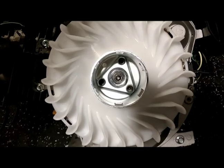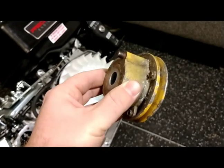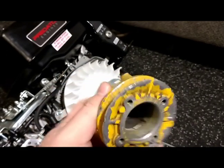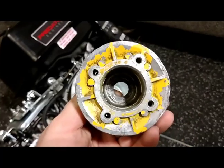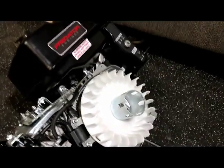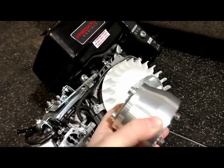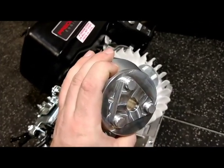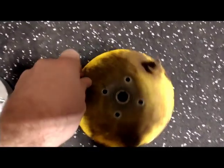Since the Predator has a triangular pattern on the recoil starter, we're not going to be able to use the old flywheel hub — there's nowhere for the gauge pin to go, and the hole diameter is too small to let the crankshaft pass through. So we need an adapter. Thankfully there's a company on eBay that sells an adapter taking the Predator 420's triangular pattern of three round bosses and adapting it to the four-hole pattern that goes onto the clutch drive plate.